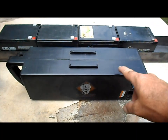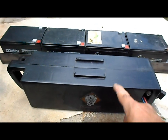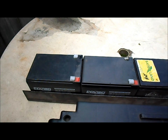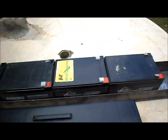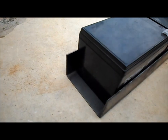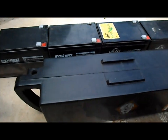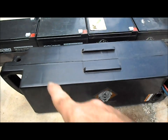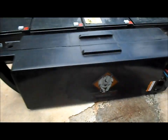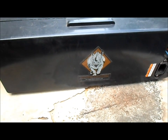Here's the battery box that came out of our little mini bike when it was 24 volts, with two 12-volt batteries. Now we're going to boot it up to 48 volts, so we're going to use four 12-volt batteries. I got this nice little metal tray to set them in. I think I might try to incorporate part of the battery box back in so we've still got our badges and stuff.